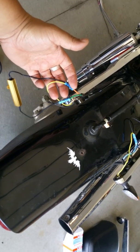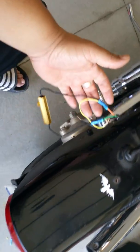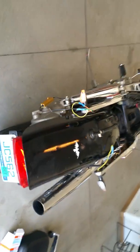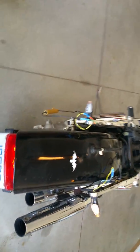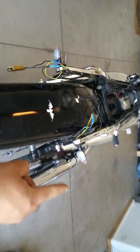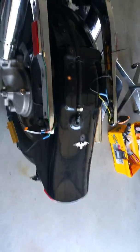So if you're having problems with your LEDs, stop by AutoZone and pick up the load equalizers or load resistors — they work perfectly now. Check it out: before, when I hit the switch, if I went right, this one would stay lit and all three of the other ones would blink. Now they're working just right, the way they're supposed to. Hope this helps somebody out.